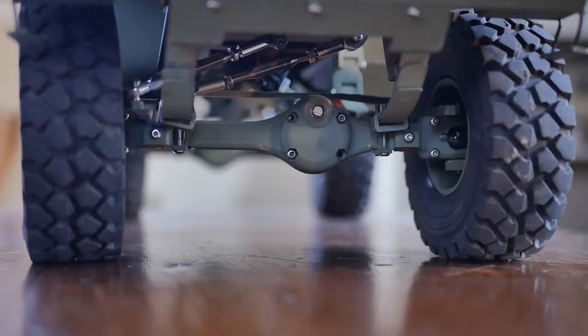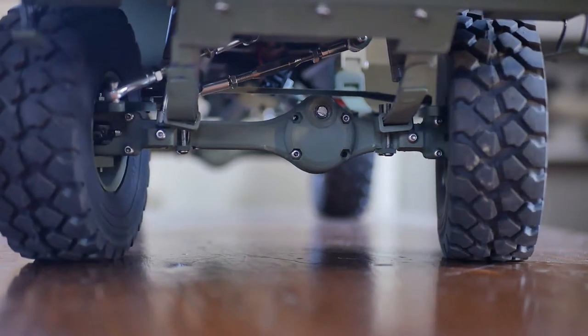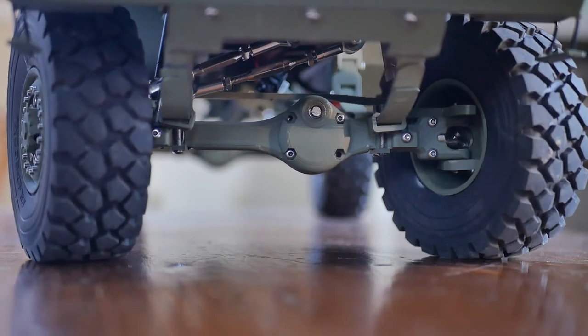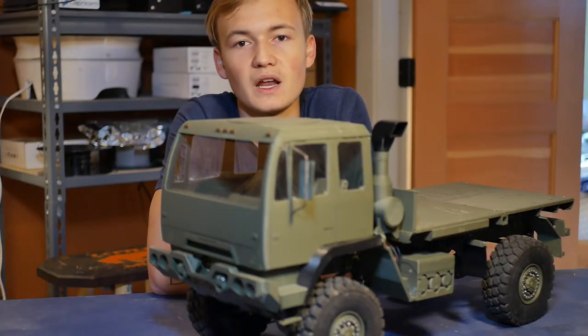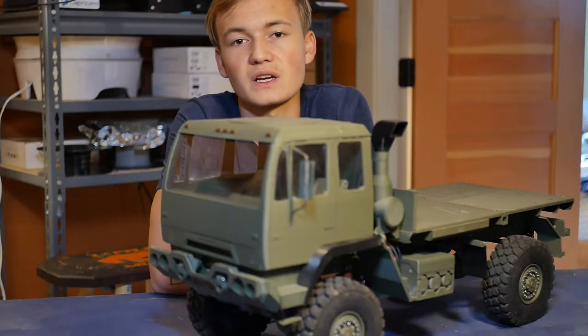The steering has been a challenge on this truck because it's made of plastic, and parts have to be really stiff to stand up to the steering forces of the 20 kg servo. The current steering system works like this: with the servo mounted in the frame, linked to the knuckle with a steering linkage. A cool feature I added — and a byproduct of this design — is that each wheel has the correct radius when going around a corner, just like on a real truck.